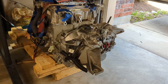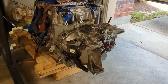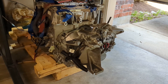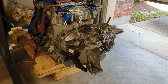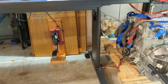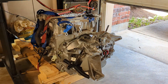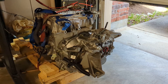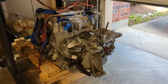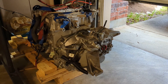We thought there was a pretty good chance that when this car was parked at the junkyard, it was probably in park. So we did hook it up and try barely hitting the pedal in both directions just to make sure it wasn't in park — and sure enough, it was. We didn't want to drive it too fast because we don't have the Nissan computer that would normally prevent the motor from turning when it's in park.